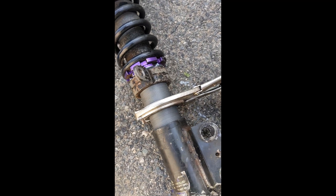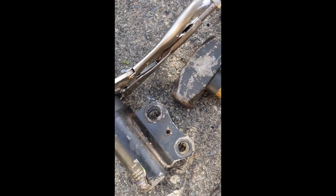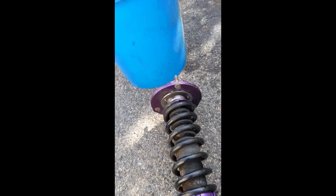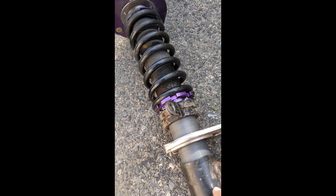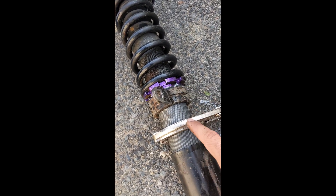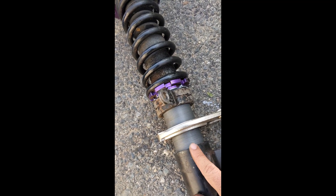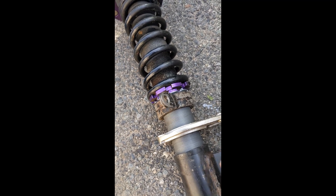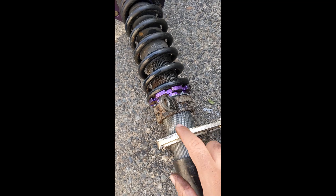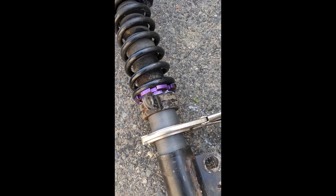So what helped me: vice grips, a four pound hammer, some WD-40, and a bucket of vinegar. After soaking in vinegar I threw it in boiling hot water to try to crack the rust off, and that helped as well. Once I took it off, I cleaned it with a wire brush, brake cleaned everything off, and put anti-seize — making sure there was no dust, dirt, or particles in the threads. I hope this helps you guys out, thank you.